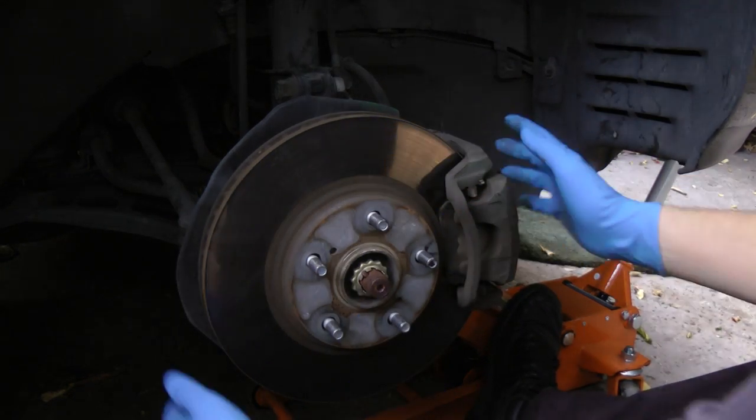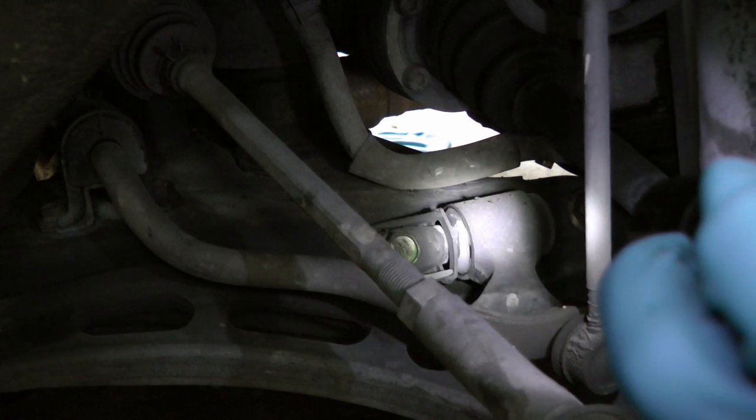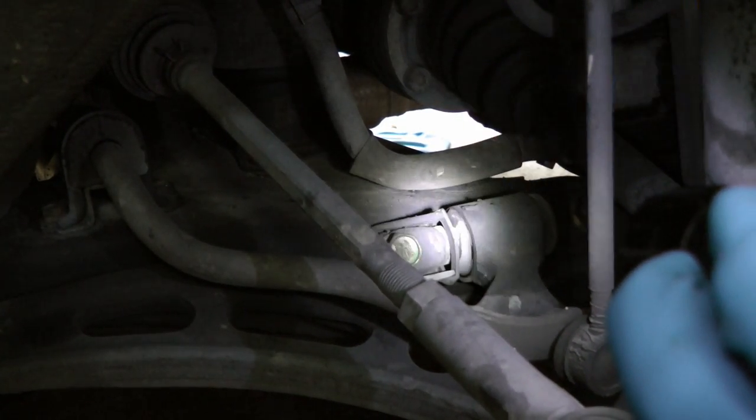Now as you can see, I took the right front tire off, and when I pull here, you can see the whole thing wiggles, and of course it shouldn't move at all, so we've got to find out what's causing the wiggling. When we wiggle it here, we can see that the whole bushing here is moving up and down.